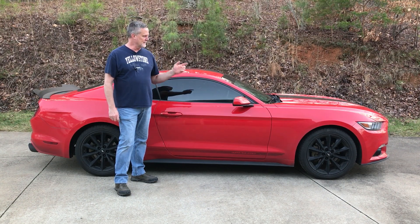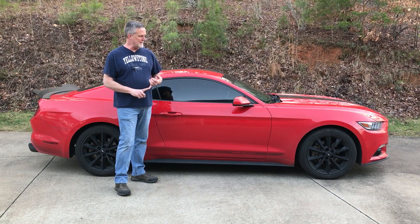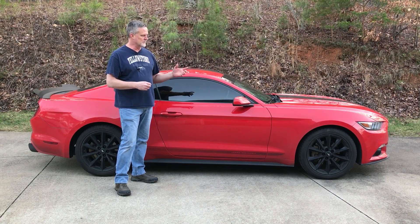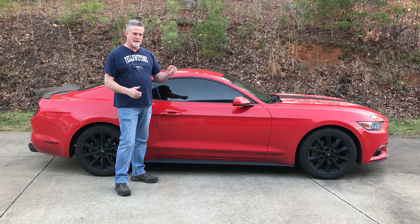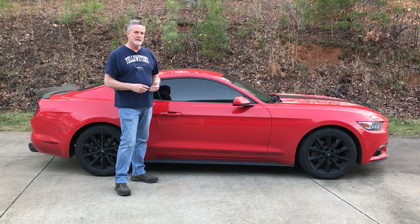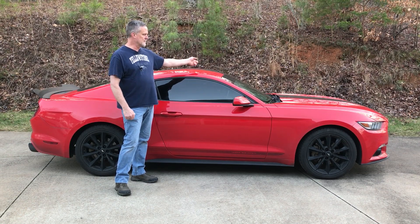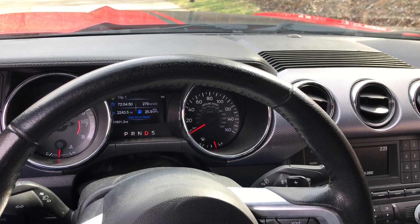If you own a 2015 and up Mustang and you get a popping sound when you put your brakes on going forward but not backward, then this video is for you. I'll show you how I diagnosed the sound, where it was coming from, using microphones, and then show you a video of the ball joint actually moving. You can use automotive microphones that clamp on to places, or just a cheap microphone taped near each wheel. I'll go forward and brake — just listen for the pop.